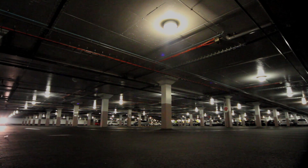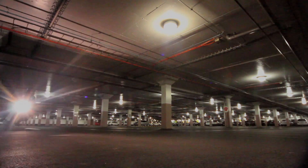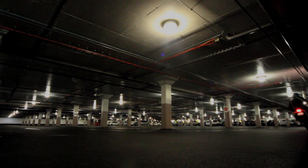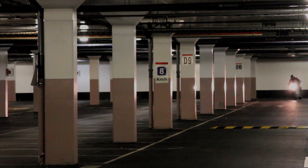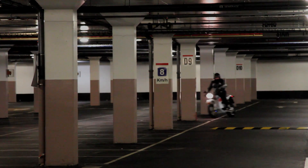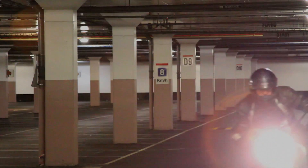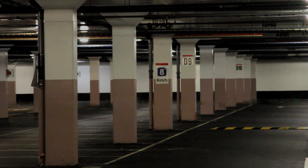I pushed it at one point until the power ran out completely. There were a few k's left in it even once the dash read zero and it was beeping at me non-stop. Unlike some other electrics, the Zero doesn't slow down or lose power at the end of its battery charge. Instead it rides perfectly normally with full power until it comes to a dead stop. So it's really up to you to manage how much power you use if you want to get maximum range out of it.